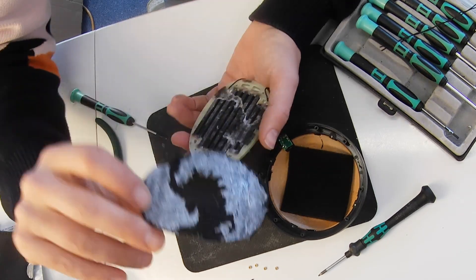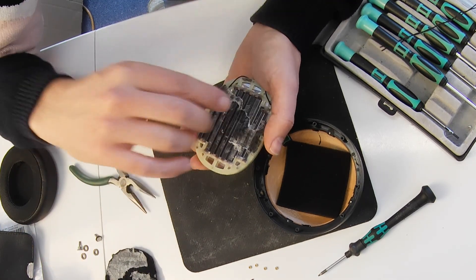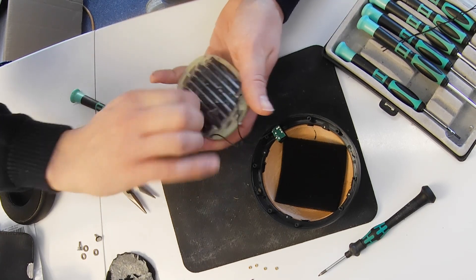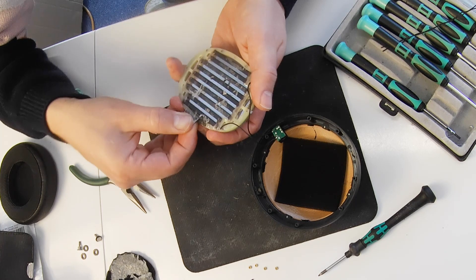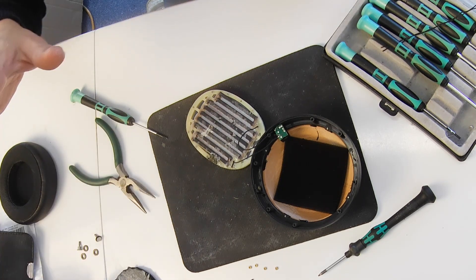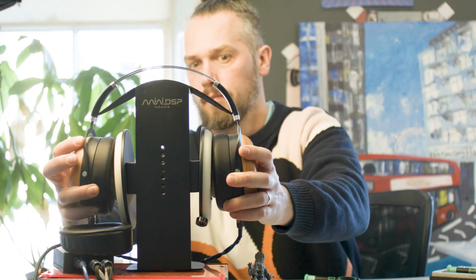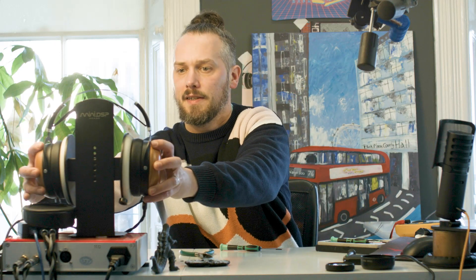Okay, so that's mostly removed. On there you can see the star cut in it - that's held on with double-sided tape. Unfortunately some of that has stayed on there. It's quite interesting that most of this driver was kind of blocked off. I suspect that's how they've made it sound okay in a closed back. I'm just fascinated to see what this does - obviously they spent a lot of time testing different shapes, otherwise you wouldn't cut a star pattern. Different shapes and sizes will affect the sound. Let's put this back together and do another test.